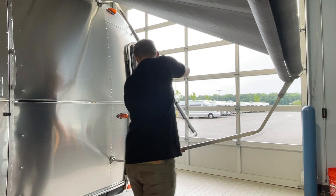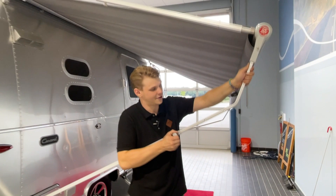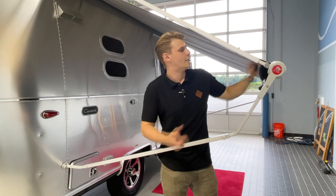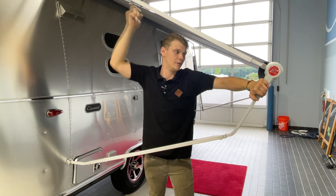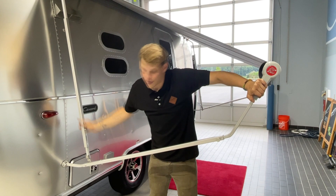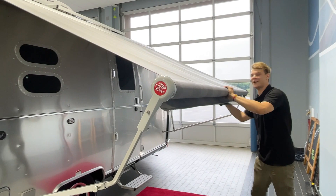Now make your way over to the other arm, pull the release, and allow it to come all the way back in. Then release the rafter arm again — this time, the barrel is going to want to come right towards you the minute you remove the rafter arm. Firmly hold the barrel before you remove the rafter arm and bring her home to her clip. Now hold the awning out just by hand, grip the barrel, and make your way to center, to your fabric strap that you tucked away.